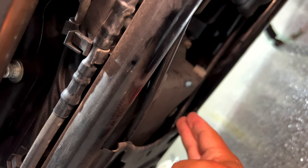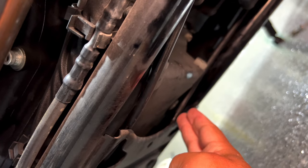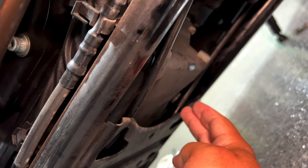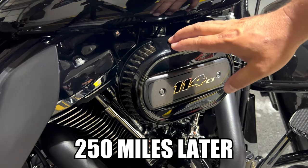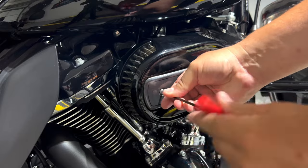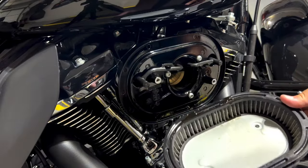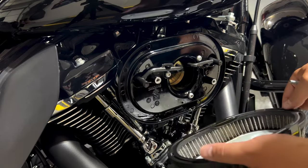It ends up in there. This is just for now — I'd like to monitor everything and see how it's going to work. I think this hose is long enough to provide some extra space for the air to escape. I'll keep monitoring if I have any oil coming out — hopefully it will be just air. So let's open up the air cleaner and see if we have any blow-by after the installation of the vent in the transmission cover that releases pressure from the crankcase. There is still a little bit of blow-by, but I have to say — definitely less than it was before.